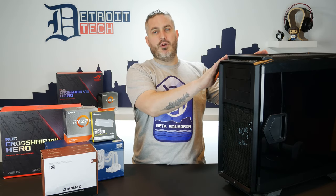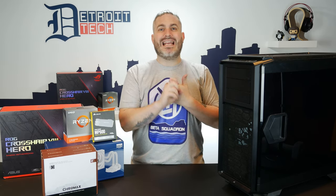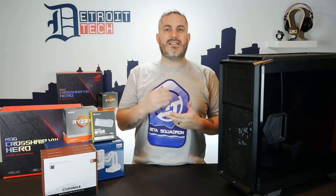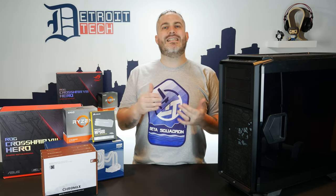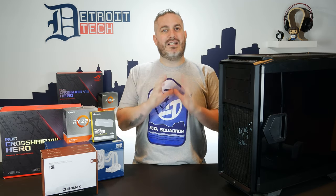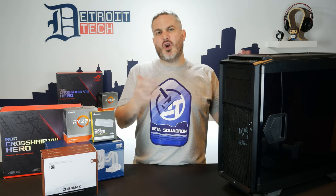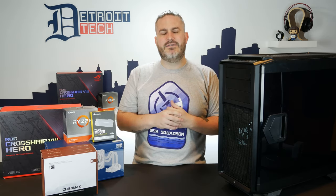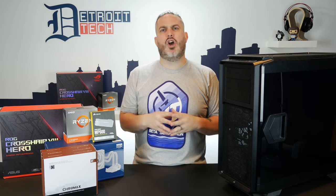Let's go over what we're using from the old computer. I'll still be using the graphics card, a Zotac GTX 1070 Amp Extreme. The EVGA Supernova NEX 750-watt power supply stays, as well as the 32 gigabytes of RAM — G-Skill Ripjaw V-Series DDR4 3200 speed with a CAS latency of 16. I would like some faster RAM, especially for the Ryzen, but it just wasn't in the budget. The venerable Corsair Graphite 760T case stays, as well as a slew of hard drives including some Samsung 850 EVO SSDs in varying sizes and a couple of spinning drives for backup and long-term storage.